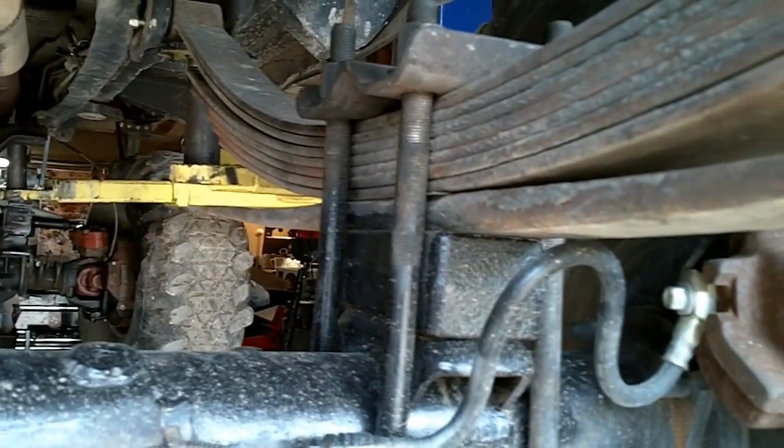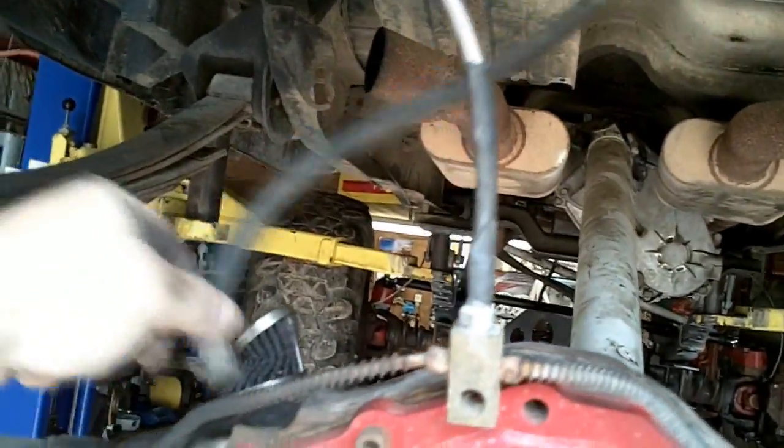The rear setup is looking pretty good. Got it all done. Give you a rear view. Got the brake lines run. I need to make a better tab for up top, and I do need to bolt this part on. For shocks, I'm still debating if I'm gonna use what I used before, which is this bar going across right here, or if I'm gonna actually make something. I still gotta do bottom shock tabs. Haven't done that, and I still gotta run a breather hose for it. And here's my stock one I used to have in there. I need to try to put that in there, but it's kind of old. I might as well replace it.